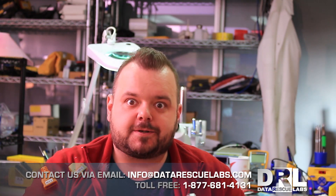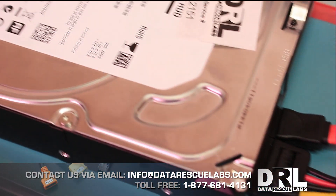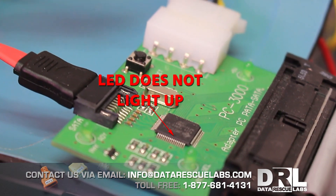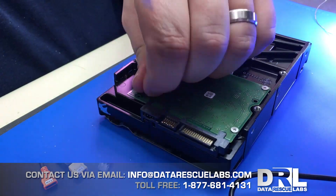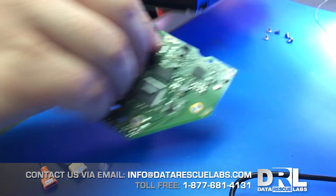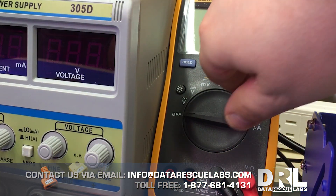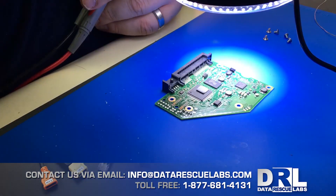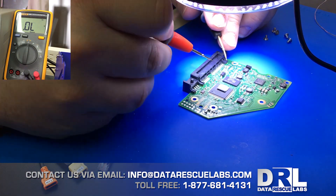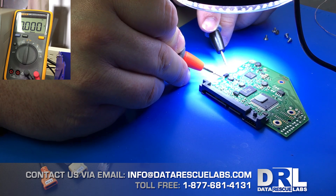Here's the footage of that job. First thing we do, we're gonna plug the drive into PC 3000 to test the board and give it power — and no light, that means it doesn't work. Now we're gonna take the board off and look at it under the microscope because my eyesight's not very good. Then we're gonna use our multimeter in diode mode and test some diodes. This one here gives us a good reading — that's fine. And this one here gives us zero, which means it's bad.